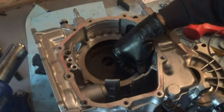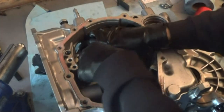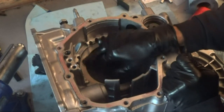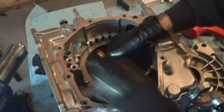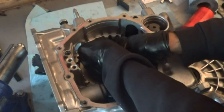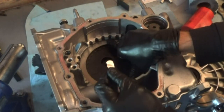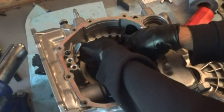Now we're going to put a clutch on top of that, and then we have the snap ring. On top of that I'm going to put the reaction plate, and then the other snap ring that holds that in. Now we're going to check the clearance between the pressure plate and the snap ring we just put in. You can push the pressure plate down and try to fit a feeler gauge between the pressure plate and the snap ring. The clearance spec is between 0 and 0.16 millimeters. This feeler gauge is 0.063 millimeters and I can't fit it in, so we're within spec.